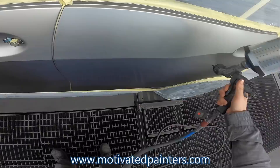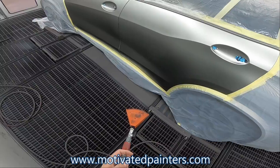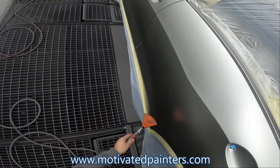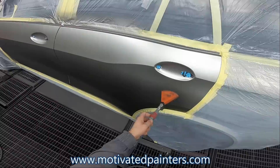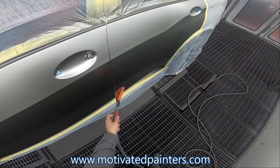As I get to the right side, I'm angling the gun kind of to the left because I want to try to get away from the quarter panel — staying away from any overspray or anything like that. Because I put on the wet bed, which is like a beautiful substrate, I was able to put it on a little bit heavier. And that's one of the advantages of using the wet bed, which I love. When you have the right substrate, it helps a lot to make things work nicer.